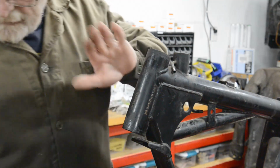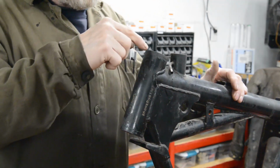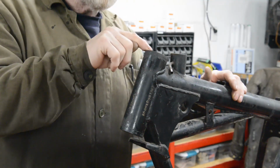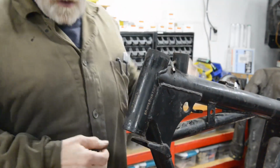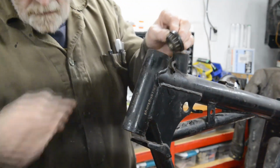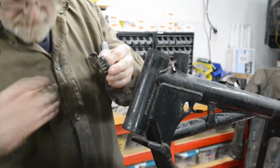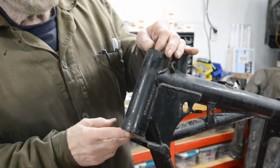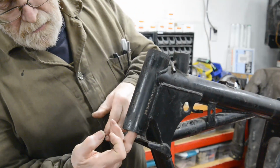Now then, the B25s, B50s, what have you, the oiling frame. The bearings here, unlike say the Enfield, don't have the good old British, and Japanese, way of having races with loose balls in them. They went to a tapered roller bearing, and they fit in there thus. There's actually no outer race in these.